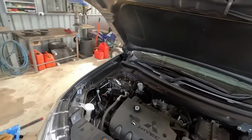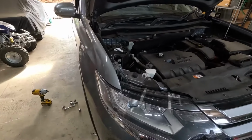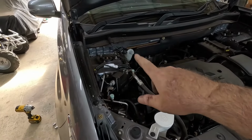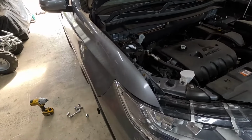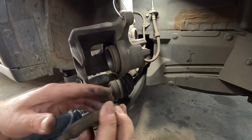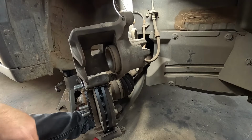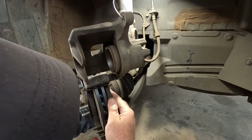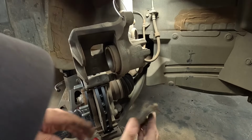And as you're pushing that caliper piston back in, just always pop your head up every now and often and have a look. That should be enough, just for that side at least anyway, but just keep an eye on it. You just don't want it to overflow. They really are in good nick, them pads. They didn't need doing at all, but hey, it'll stop that slight wobble in the caliper anyway. Okay.